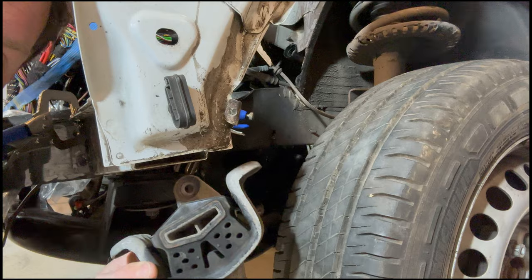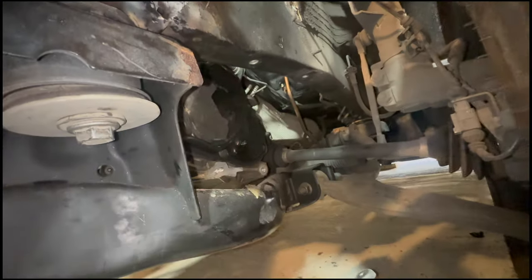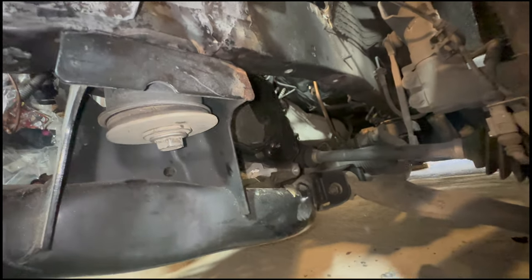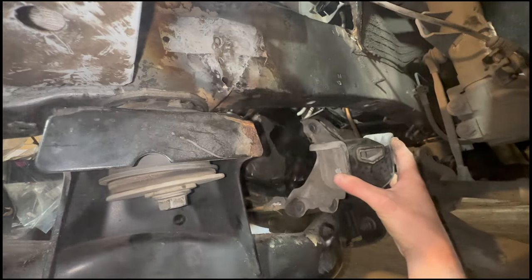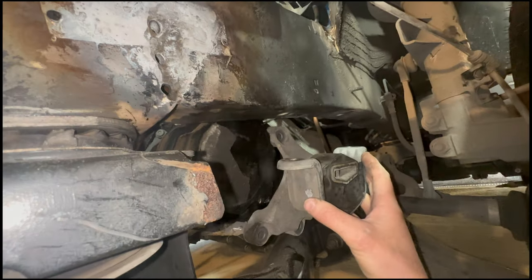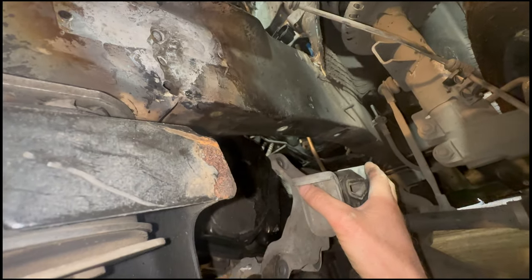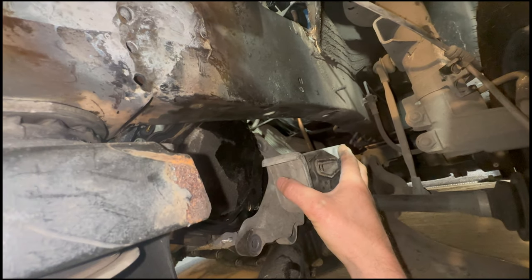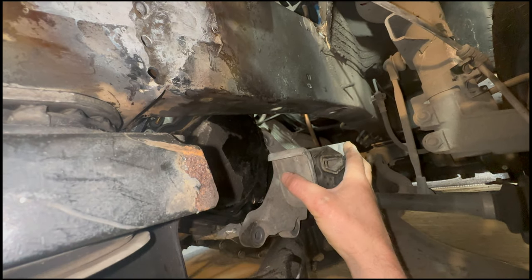And now I've got this gearbox mount. I had one before, but it was the wrong mount. So this mount goes, got two fixing points at the bottom there and then one at the top in here. But as you can see, we're about 60 mil short. It's also got a fix into the bottom of this chassis leg. We're about 60 mil short of that, so we need to get the whole gearbox, gearbox and engine moved up, so I can get it into that as well.